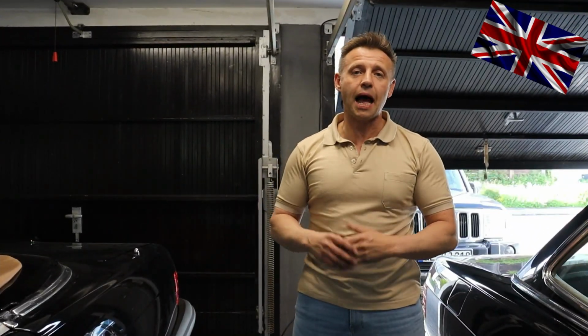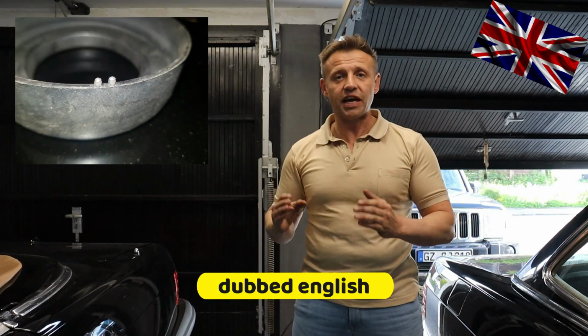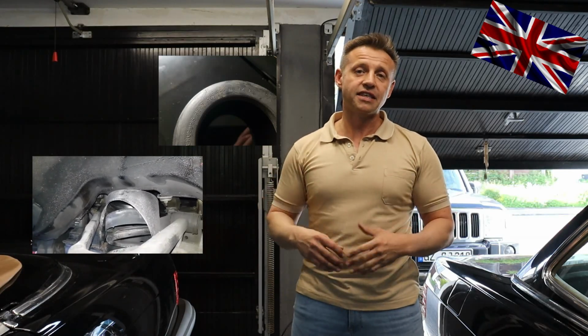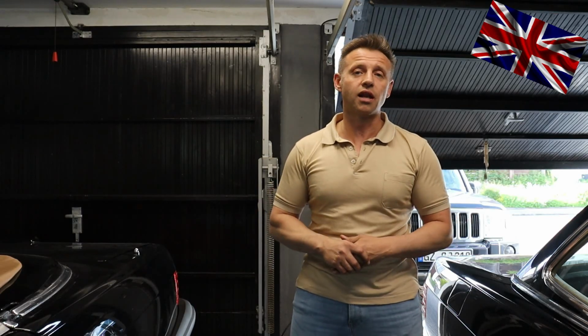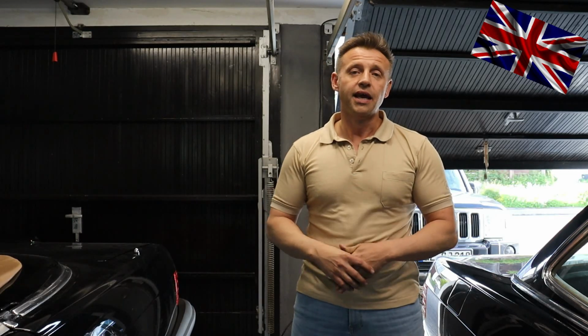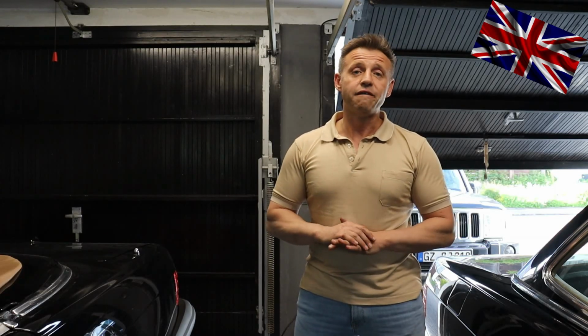You actually alter road clearance 1 to 1.5 centimeter with every notch that you add or take away. I hammer away on this topic, and I really have to hammer away. Removal of the springs is dangerous, and you have to take your time and be twice as careful as you usually were. Always make sure that the cross member is supported in a safe manner to avoid injury. It does not matter if you get this job done with a proper internal spring tensioner or any other way, it is dangerous, beware of that.